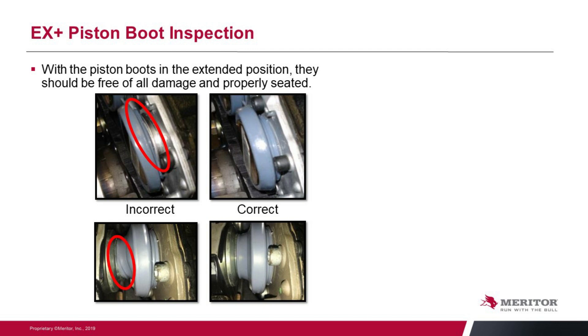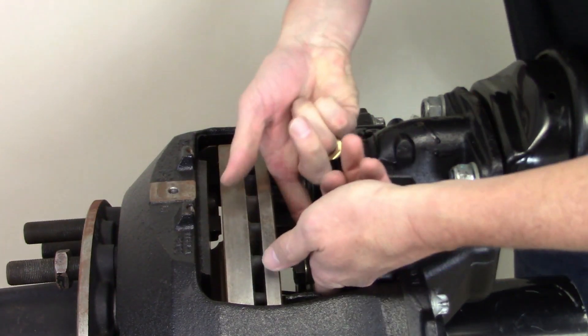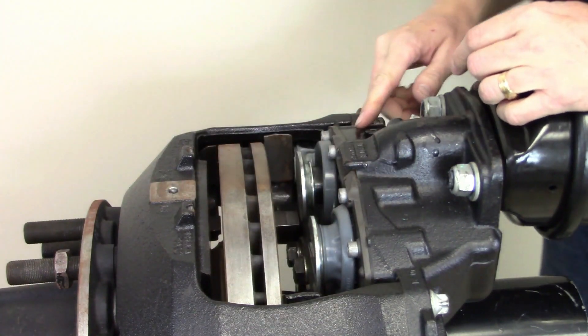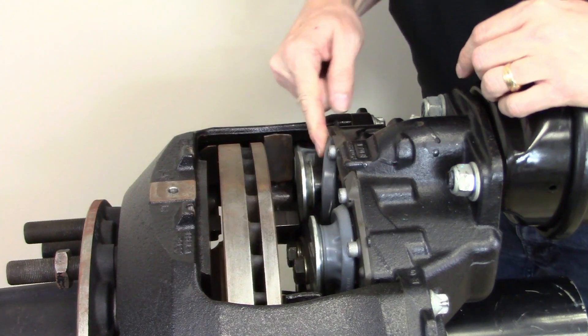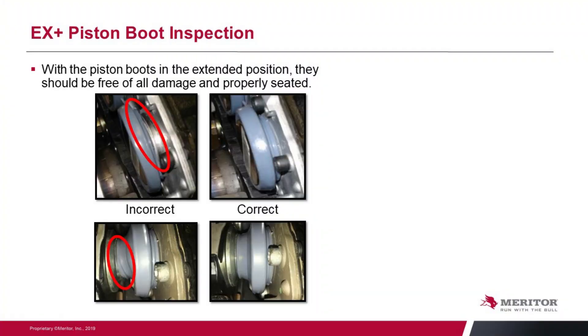The same thing applies to the piston boots. You need to inspect them and make sure they are installed correctly. Sometimes they're difficult to get in there and it's hard to see underneath the bottom. I know certain times I've seen mechanics who actually use a dental mirror and reach under there to make sure that everything is installed correctly. But if you get them on properly, you're not going to have any issues or damage — those pistons are going to be properly sealed. The video shows this inspection — one boot is properly set and everything is in the right place, while the other boot is off of the mount and needs to be put on and sealed all the way around 360 degrees.